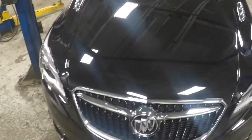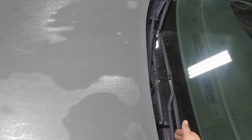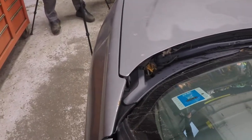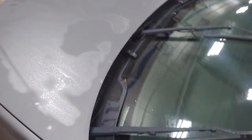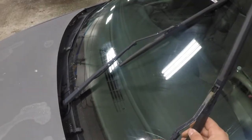So we're going to jump into a little older vehicle with the old hook style. We're now into a Chevy Impala, a few years older than the Buick. You can see what I was telling you about clearance — you can see where the blade is going to contact the hood if I try to lift it up. So I'm going to see if the keys are in this vehicle. I've turned the key off, and now the wipers have parked themselves up in the middle of the stroke. So now I can go ahead and lift that up — I've got lots of clearance here and it's not going to hit the hood, and I can work on the wiper blade.